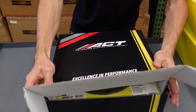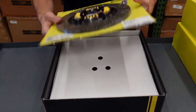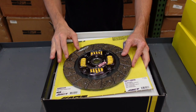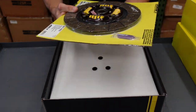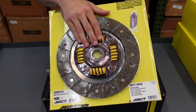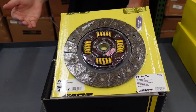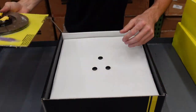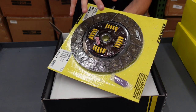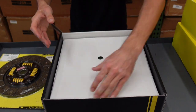The first one here is the heavy duty clutch. Let's pop this thing open and take a look at it. When you open this up you're going to see first off your clutch disc. ACT uses a four stage heat treatment on these clutches to make them very durable — this is a good solid quality clutch. It's also going to come with some grease so you can grease up the splines when you install this. Make sure you're looking at the orientation of the clutch; the back side and the front side are just a little bit different — one side goes to your transmission and the other side faces the engine, so you don't want to put this on backwards. These also have high copper content for better heat transfer so your clutch isn't going to get super hot, and it also has a steel lining on the back that helps with burst strength so you won't have to worry about that clutch exploding on you.